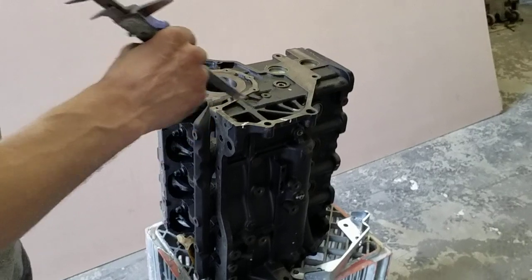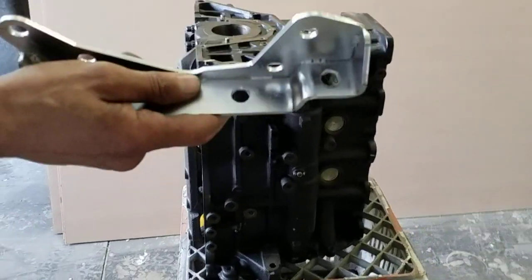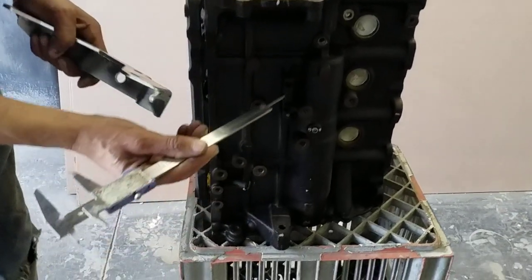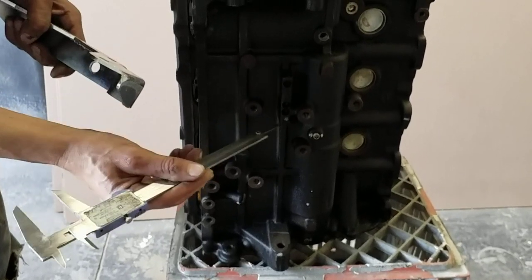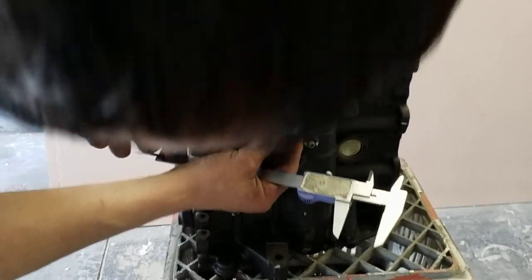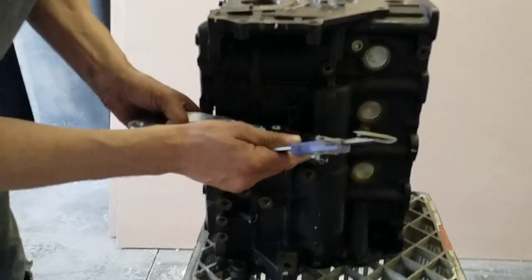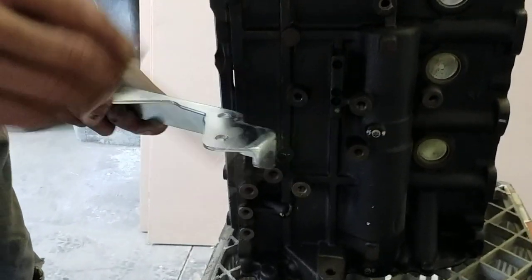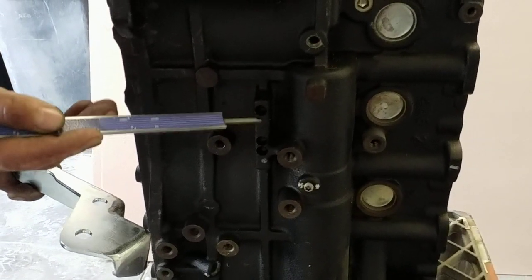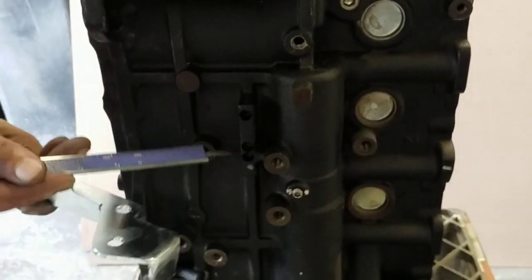Once you've got that material removed, the next thing you want to do is get the transfer bracket mounted. We'll be using that hole and that hole there. Now this square bung over here needs to be removed — but you don't have to take it completely away. Just lay the transfer case bracket on and start removing material until the bracket goes on with at least an air gap behind it. Don't only take off where the bracket is — take it right the way through, because this is actually going to be in the way of the transfer case as well. But don't go overboard — just enough to clear the bracket, and then consistently all the way through.